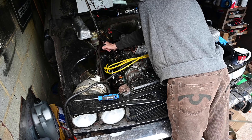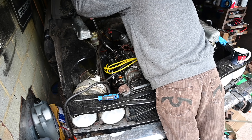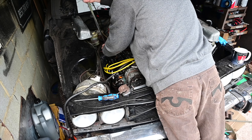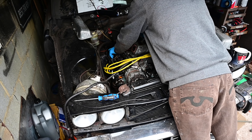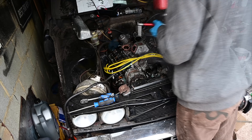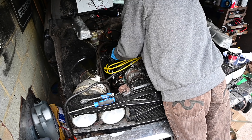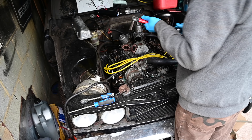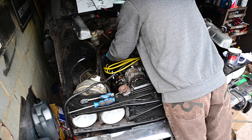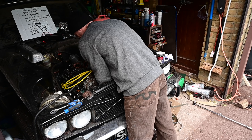It is reassuringly oily as I'm doing these things, and the little pedestals are lifting away from the cylinder head. It's reassuring how much clean fresh oil is seeping out as well, which means the oilways are clear - oil is pumping, the engine probably won't lunge itself when I start it. Let's get the little shimmy things in there. This is going easily enough that I'm very concerned it's completely wrong. Right, in we go with five then up to eight. Let's try and give this thing a turn.